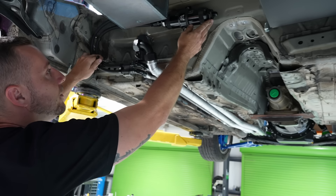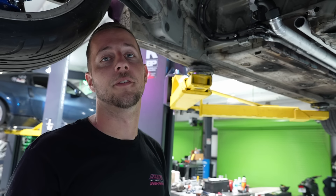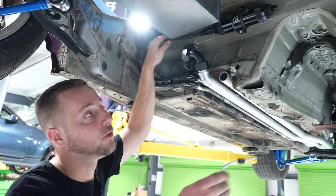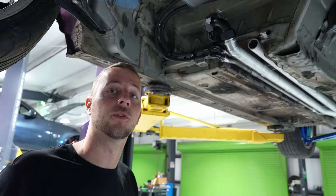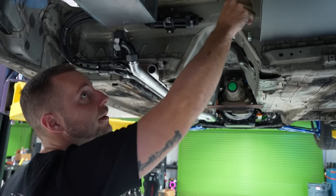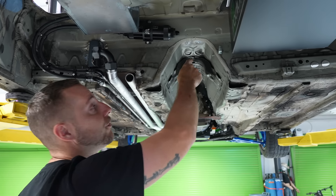We stole some parts from this car to get Mona ready for comp since we're waiting on body panels. So we decided to make Mona the car for comp, which wasn't the initial plan. Now the water pump goes back in here. I have the fuel filter mounted and I'm going to run two bulkheads for the fuel going up to the cell so everything's underneath the cover and nothing's running through the passenger compartment. The brake line from behind the dashboard will run up here and split out to the foot brake.